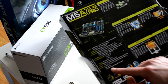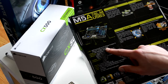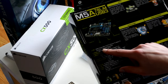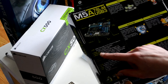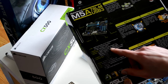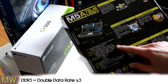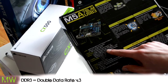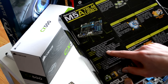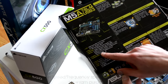These items here are quite important as they tell you what hardware the motherboard can take. You've got AMD socket AM3 Plus for FX, Phenom, Athlon, and Sempron 100 series processors. For RAM, it can take 4 DIMM dual channel, with a max of 32 gigabytes of DDR3. Here are the RAM speeds — it's important to take these into consideration when buying RAM, as if you bought the wrong speed, the RAM wouldn't perform adequately or would not perform at all. We'll go more into RAM speeds later in the RAM video.